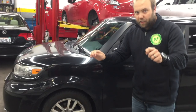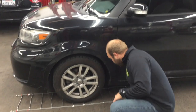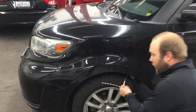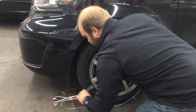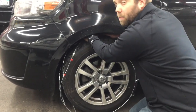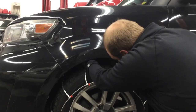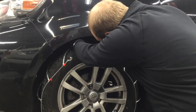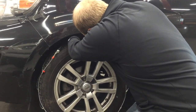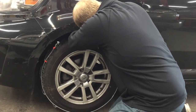This is where the connections come in. The first step is to take each end of the cable chain and bring it up around the tire. Some parts can be really tight inside, so you'll want to connect the inside of the tire first, and then I'll show you how to connect the outside so you can actually see it. In my right hand is the male side of the cable and in the left hand is the female side.